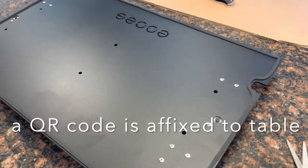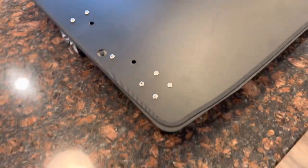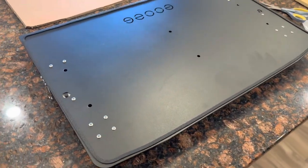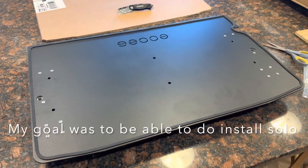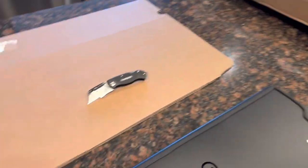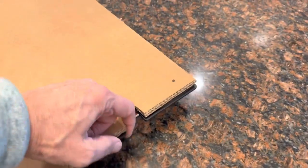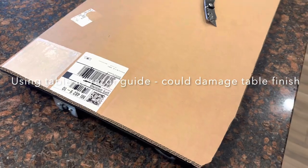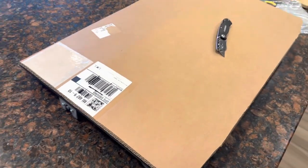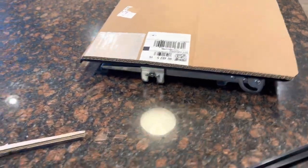When you scan the QR code of your Goose Bronco table, the instructions tell you to put weather stripping around the outer edge, which they provide. Your next major step is to hold the table up against the back of your Bronco tailgate to get it aligned and mark where the holes are going to be. I find that a little cumbersome, so I'd rather work with a template. Using the box it came in, I cut off a big piece of cardboard and made a carefully cut template that's the exact same size as the actual table. I'll mark the holes into the template and use it to measure where I'm going to drill the screws into the interior side of my tailgate.